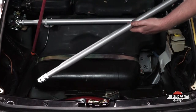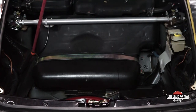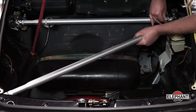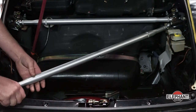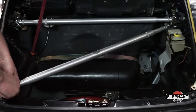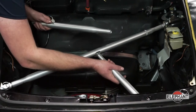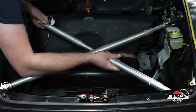Next, I'm going to install the single piece bar from the X-Kit. To start, remove the quick release pin and the bar so that you can access the pin for this brace. Now I'm going to adjust the bar until it's the correct length to install the other quick release pin. The bar is adjusted properly when the pins can be inserted and removed freely. Once that position is found, rotate the bar until the hole is horizontal. Now install the two-piece bar with the knurled portion towards the front of the car.